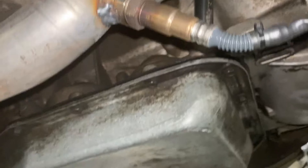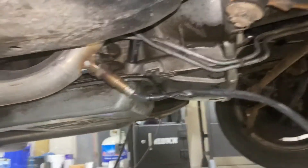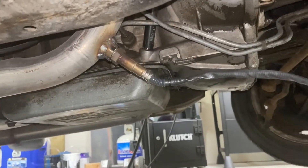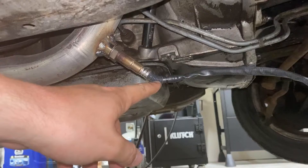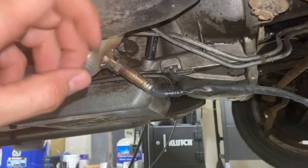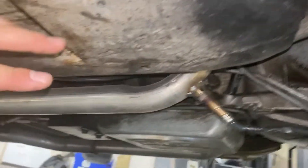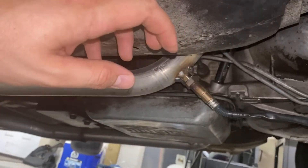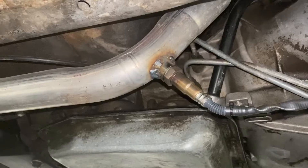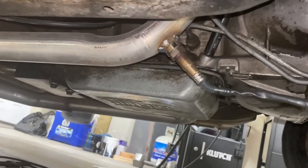I'm not going to lie — this isn't the best welding I've ever done, but when you don't have a lift it's kind of tough to do on your back. No leaks though — that's the big thing. The one thing I don't love about how I mounted it is ground clearance. I don't think it's the lowest thing on the car but it's definitely kind of down there, so it's something I'll have to be weary of. Ideally I would have put it at a different angle, but there wasn't a ton of room. I went ahead and tucked the wire away, keeping it away from any heat sources.